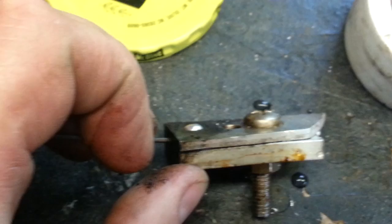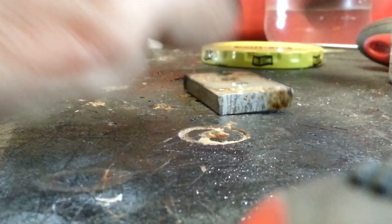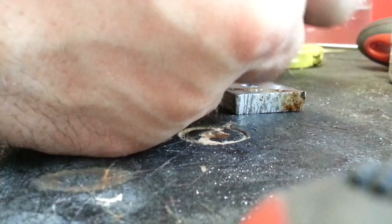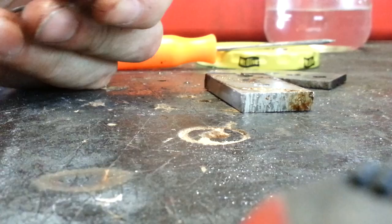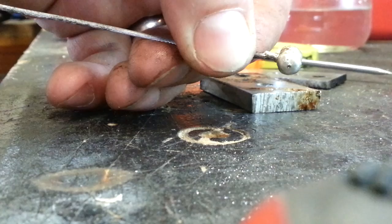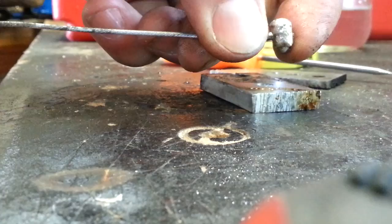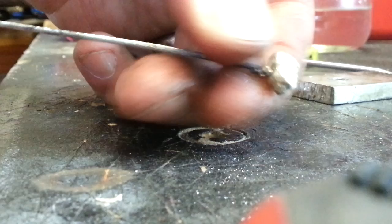And there's our fixture. I'm going to pull the nut off the back and take it apart — let's see what we get when we demold it. I've taken the bolt out, releasing the two blocks, but they've stuck together — probably because the solder worked its way into the textures of the molds. I'll pry it apart physically. Just a little tap with a small punch was enough to knock it free. And here it is — it's not exactly perfect, but it's not terrible, and it will definitely do the job. The bottom has a bit of a point from the drill bit used to create the hole, but she's on there, and that's not coming off. I'd have to cut the cable to relieve it.